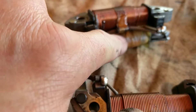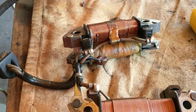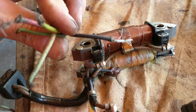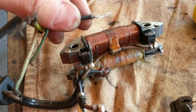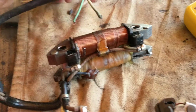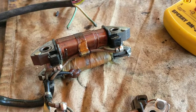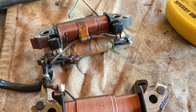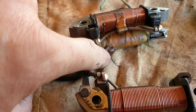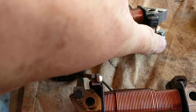The bottom coil is the ignition coil, which comes out in a black wire wrapped in some fabric. The resistance between this wire and the earth connection is 0.35 ohms. The wire goes inside here — it's insulated — the coil is here and it comes out at this end.